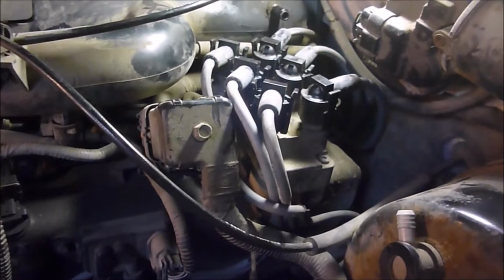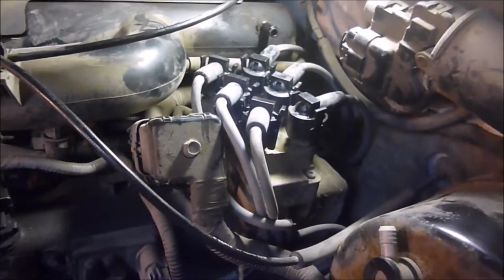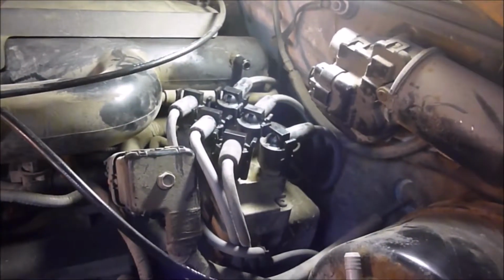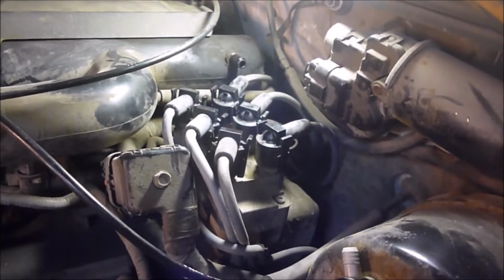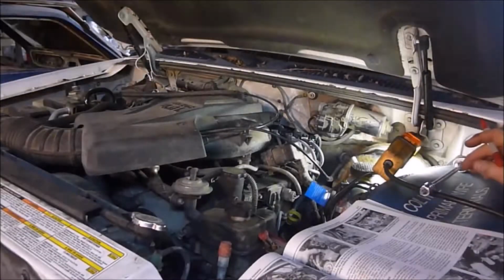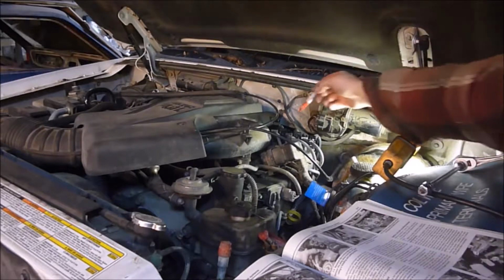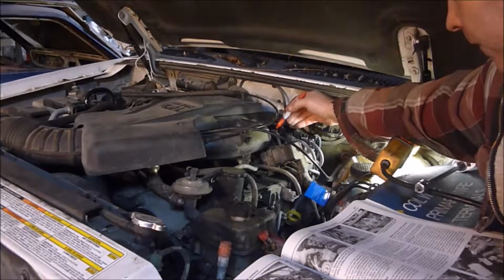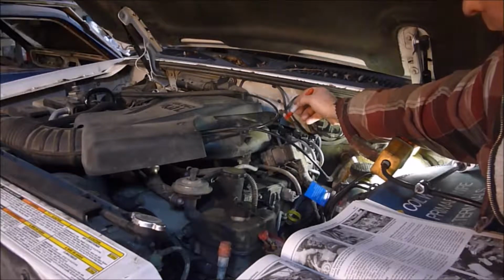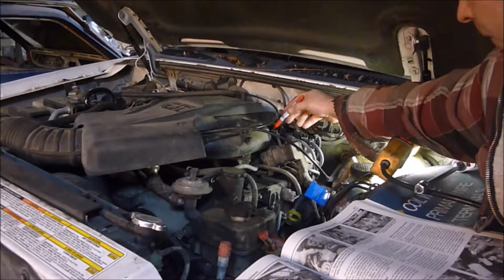Anyhow, the way I did that, that's secondary resistance is what they're calling that, checking it through there. Now I'm going to check primary resistance, and to do that it looks like I need to pop this thing off of here, and we'll go from there. I'm going to take the book here. I can see on their diagram what the numbers are, and I'm going to mark them, see if this will mark anyway. Looks like it will. So set them that way. So this is 1, 5.